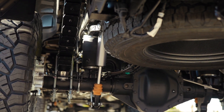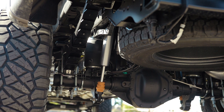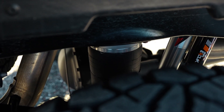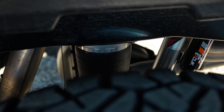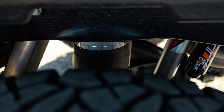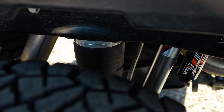The next comment about those leaf springs is: why would you remove the capacity on the F-350 or F-250? Well, there's a product for that — the long-travel airbags. These are gonna allow the extreme suspension travel that the 4.5-inch Carli kit does, while still giving you a fully-functioning airbag. This customer will be able to load up the bed of the truck, grab a dump trailer or an RV, fill up those airbags, and actually sit level and tow completely safely on the weekends. And yet still, once he unhooks or unloads, let the air out of those bags and you're gonna see an extremely smooth ride. The design on this airbag is a little different from other options on the market — on purpose — to allow full suspension travel and the least amount of ride impact as possible from the airbag.